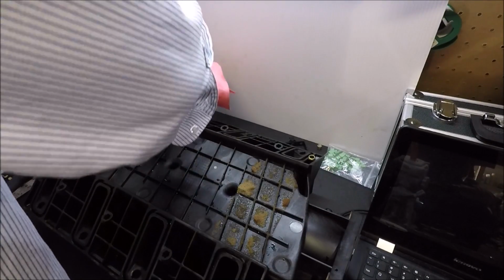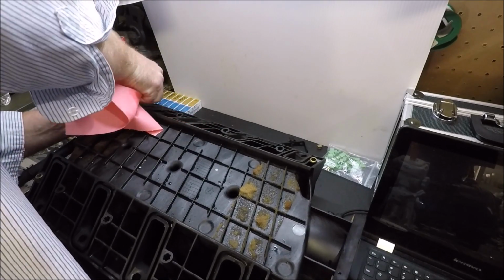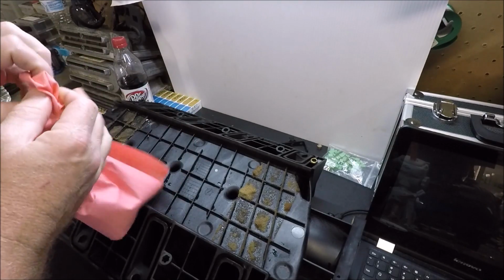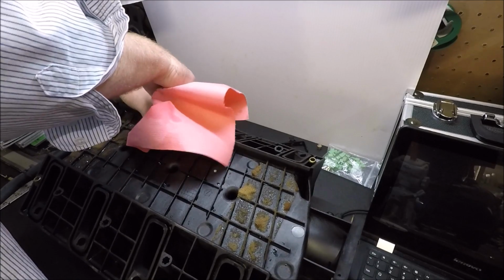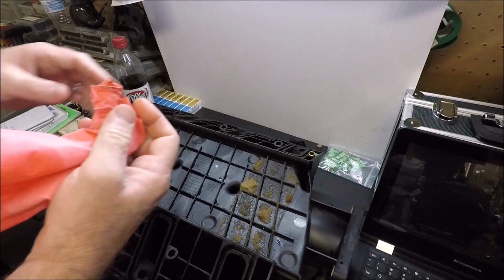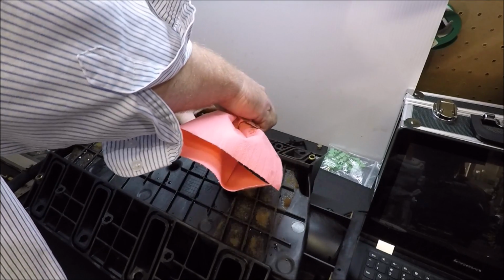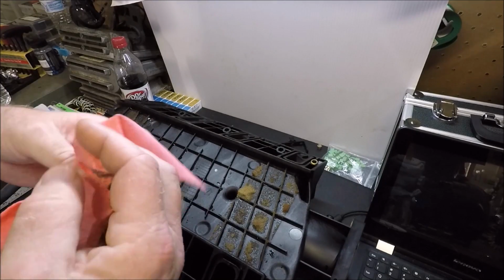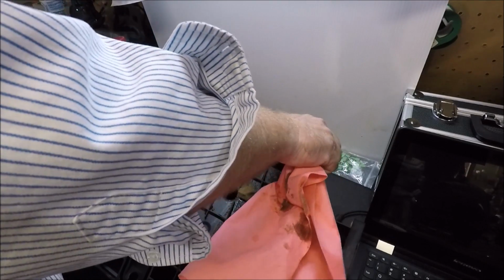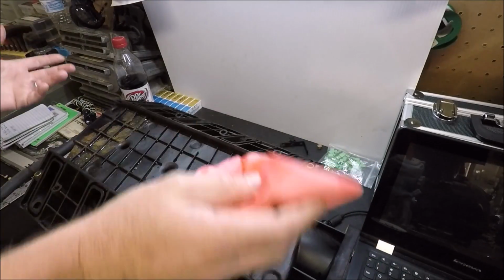A lot of you have made suggestions to me that I should get an LS6 intake. Well, as you can see, this is an LS6 intake. In case you guys didn't know, after 2001, GM started using the LS6 intakes and the revised LS6 engine blocks in all Corvettes. So it doesn't matter whether it's a Z06 or not. If you've got a 2001 and up Corvette, you already have an LS6 intake, and you already have an LS6 engine block. You just don't have the LS6 valley cover. But what's cool about that is, since you've already got the LS6 engine block, you can put the LS6 valley cover in there without having to grind anything in the valley to fit the baffle in there, because you already have an LS6-style block.